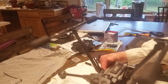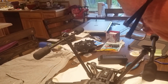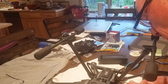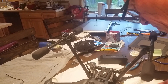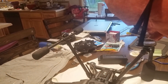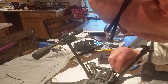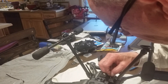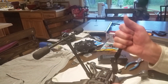The next step is the landing gear. Use a two millimeter driver on the landing gear — there are two screws. Take the screws out, then carefully lift the antenna holder so you don't damage the antenna. When you lift the gear out, watch the antenna as well.